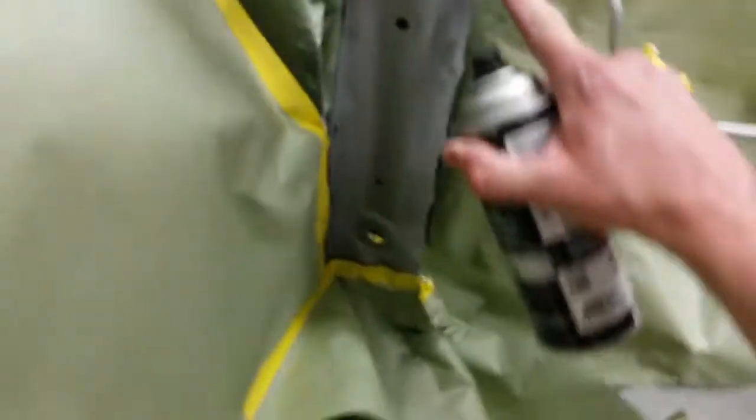Alright, I've got the repaired support here ready for some easy coat. Got the filler sanded out right here where I had the vice grips, and back in here where I had a little bit of filler over the tool marks from the slide hammer on that. I had to pull that out with a slide hammer because I can't get back behind it from this direction with the hammer. So I got it flat as I could get it. And I just put fiberglass filler over that, smoothed it off.